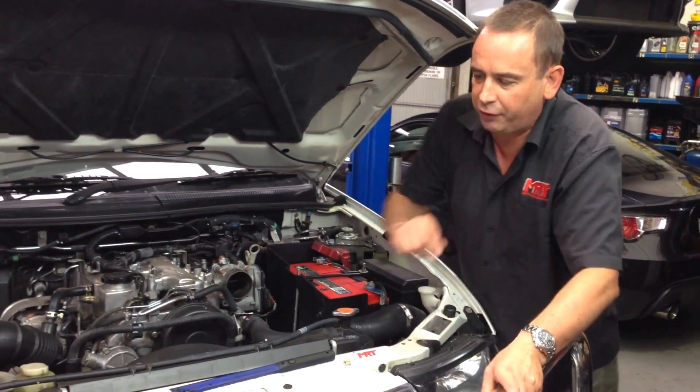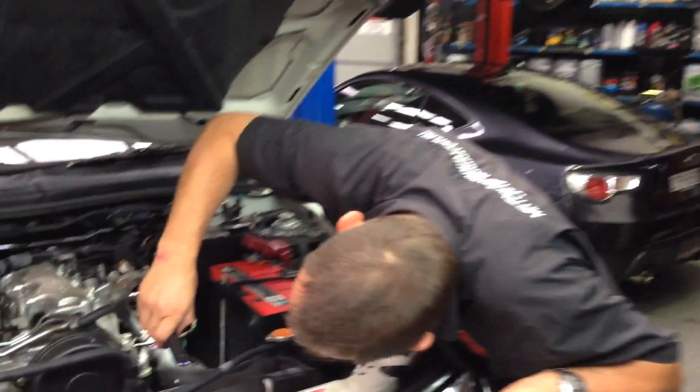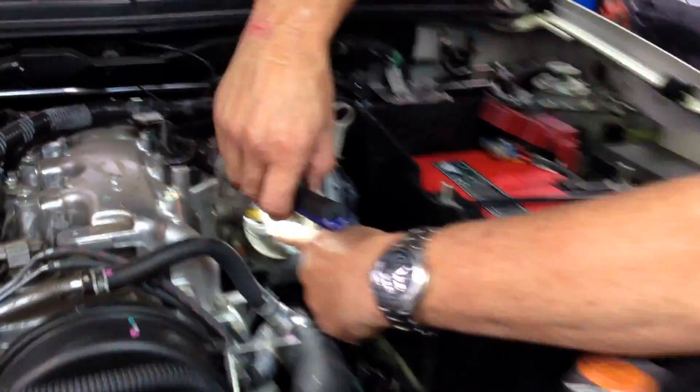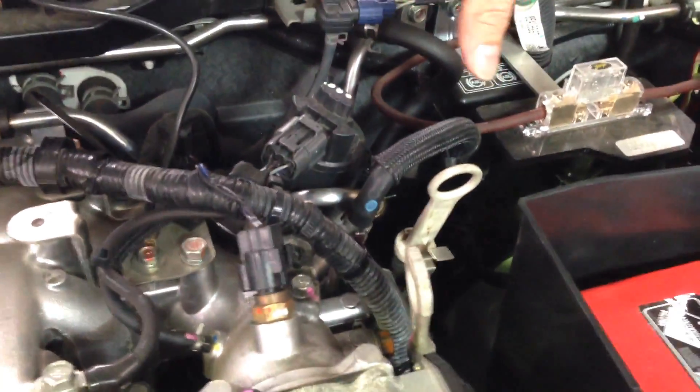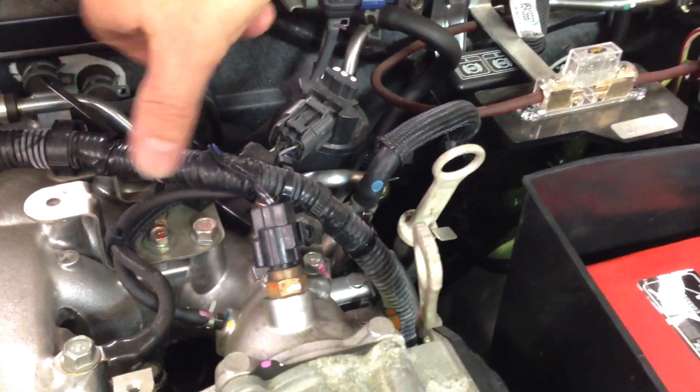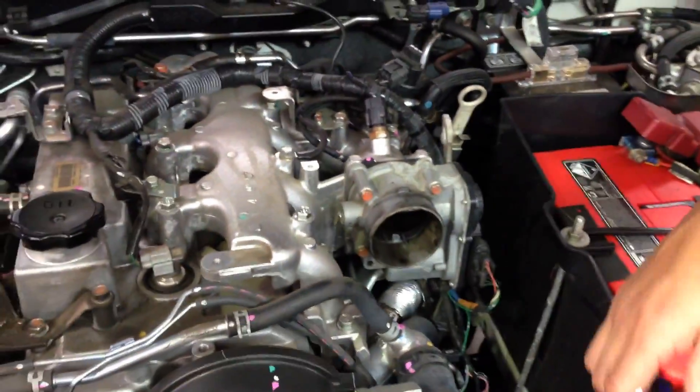What I can show you — it's a little bit difficult to see — but right down inside there, past the butterfly, is where the EGR valve comes back in. If you can imagine back here where the EGR valve is bolted onto the side of the inlet manifold, that's where the soot starts to build up and then starts contaminating all this side of the inlet manifold.